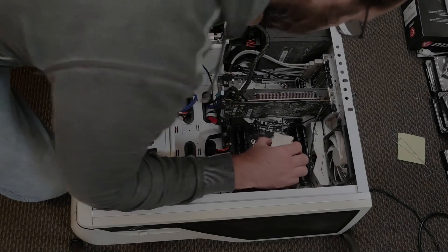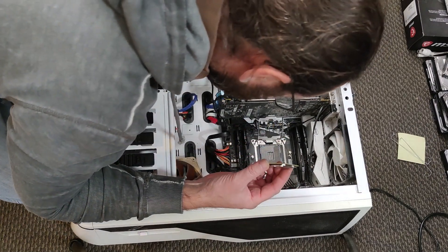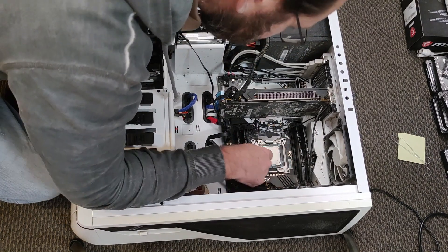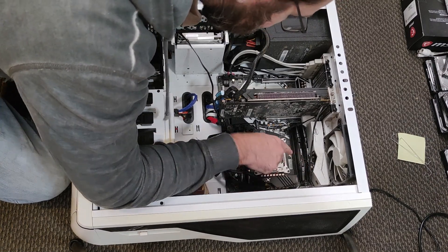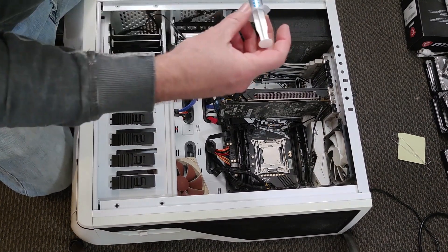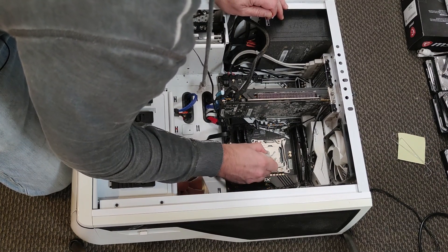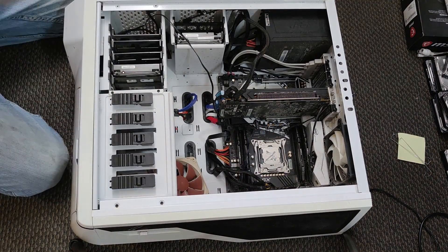The new one goes in. That should go that way, like so. That one first, that one second. Then we need a glob of thermal paste — I've got this Chinese GD900 paste I've been using for a bit. It's quite a big CPU, so I need a fair amount. I also want to wipe off the excess from the top of the heatsink.